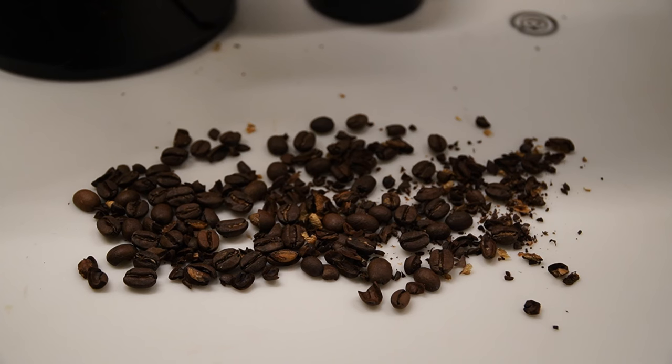So going back to what I was saying earlier in this video, having a quote-unquote true pre-breaker might be nice, but there's really nothing shown to have that big of an impact on the beans themselves being pre-broken. I mean, we don't really grind cracked up beans. We grind whole beans when we run it through a normal grinder. So while it is kind of nice and it does take some of the load off of the burrs, I really feel that the auger is there just for a more reliable and consistent feed into the burrs. And also any of those large bean chunks that may get pushed out of the burrs, that auger is going to keep it and continue to push those beans in and give it that nice reliable feed.